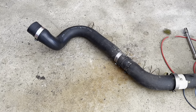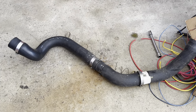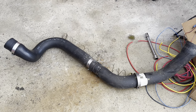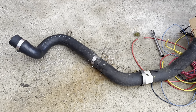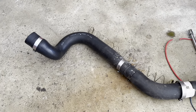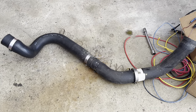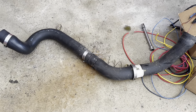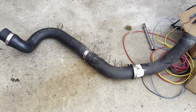In doing that searching, I did locate a single hose that will replace this whole assembly. It's from a Dodge Ram — Dayco part number 71713. I believe it's an upper hose for the Ram. I've ordered that and it's due in. The only thing I'll need to do is transfer the springs over. I already have one out and there's still one in the little Z-bend portion. Hopefully that one hose will replace these two and I can just put the two springs in the new hose.